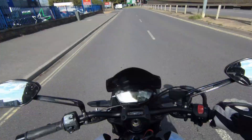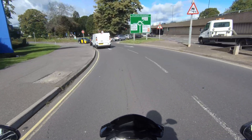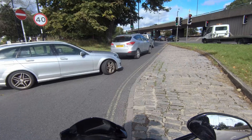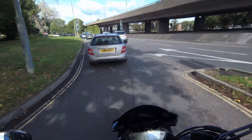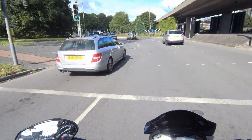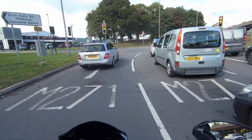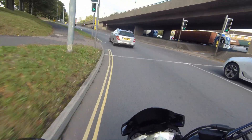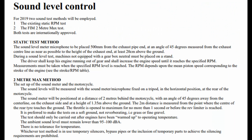Let's try and draw some conclusion that's actually beneficial here. The MIV slip-on is louder than the stock pipe and probably louder than most people would expect. Probably the most important conclusion is you can't measure your exhaust pipe with a phone because all the decibel meter apps measure in decibel A scale, not in decibel C scale. And if you try and search any of the official testing procedures, they seem to be all focused towards the decibel C scale rating because they're more interested in the deeper notes and the lower frequencies — the bassier part of the sound.